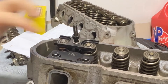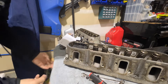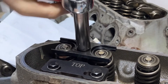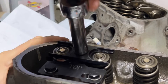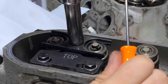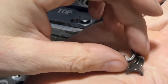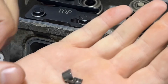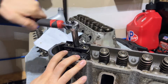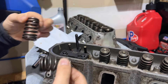I'm going to hit the bolt threads with just a little bit of oil — just enough to cover the threads. That's going to allow things to stay nice and lubricated as I tighten it down because it is a lot of force. There we go — both keepers popped out, all four of them. These will not be reused; the kit comes with brand new clips, although these look like they're in fantastic shape. Then we slowly back it out, and now we have both old valve springs out.